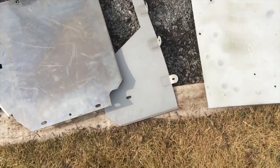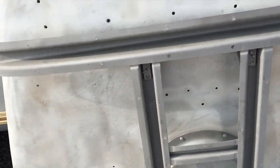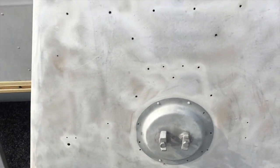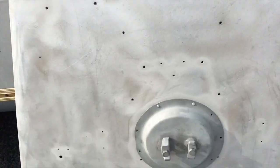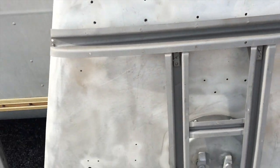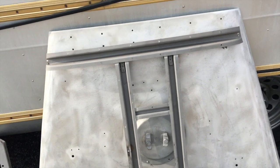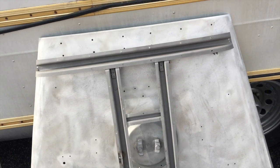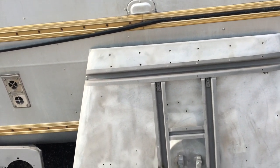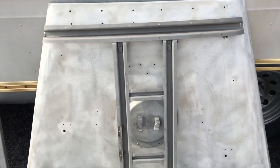We've got a heat shield for the engine and an NOS front bumper. We've got the bonnet, which has been lightly sandblasted and cleaned up, and that's the inner support. If you don't take that off, there's going to be corrosion between the bonnet support and the front hood. So you've got to take it off, drill all the rivets out, and sandblast it. That piece is then ready for galvanizing or paint — I think we'll galvanize it and then put it back.